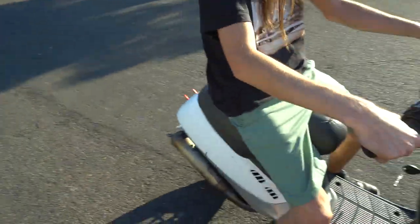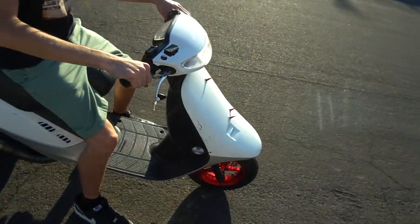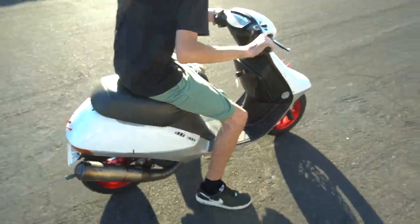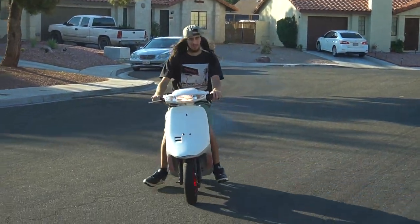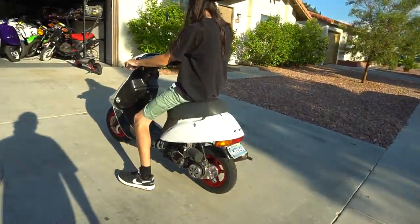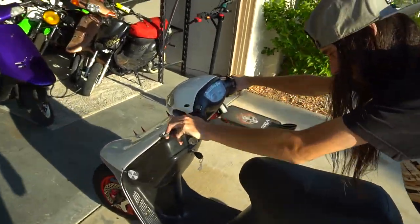It's only when you come up to the turn and then you stop. Is it usual to down jet when it gets hotter, or up jet when it gets hotter? Outside, it's like worse in the air. Also, I put the air filter on. You think that makes a big difference? Yeah, you're getting less air, so it's more gas. So too big of a jet for sure. Yeah, we need to retune it.